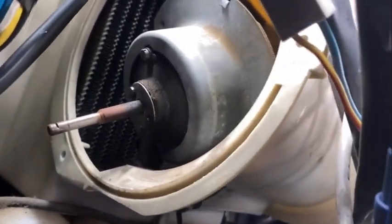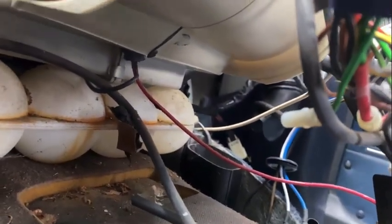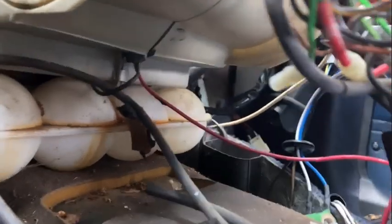So it's still plugged in by a couple wires. I have to figure out where those go. I'm pretty sure they go under here. Actually, yeah, they're right there. The red and black wires right there. But this motor's completely disconnected. Like, it's free to move. It's not even in anymore. So once I get that out, take off these two connectors, then we can put the new motor back in, the new resistor back in, and then reassemble the whole front of the car once more.